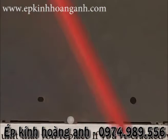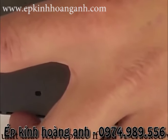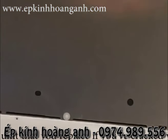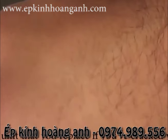There you go. Now, it depends on where you buy your screen from, but you might also have to switch out the metal plate. There's just those 4 screws around the outside. Once again, that's completely dependent on where you get your screen from. I'm not going to do it on this screen just because it is super simple. 4 screws, pop it out, good to go.